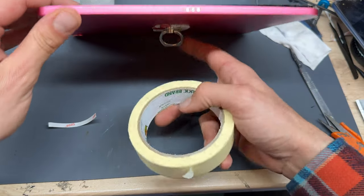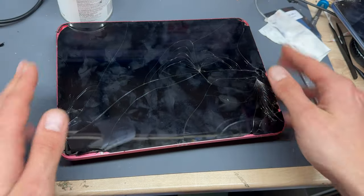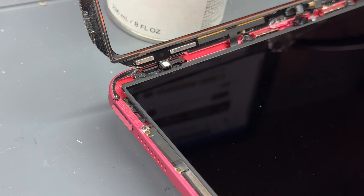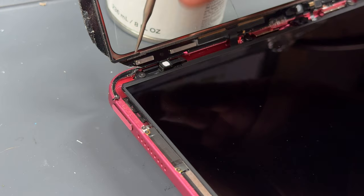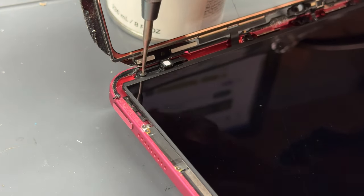Just a little note: if you've ever got one of these pulley ring things on there, if you pop it on a bit of tape and rest it on there it means it'll sit fairly flat — a top secret tip from the iDoctor himself. To begin disassembling this iPad we're going to remove the eight T2 screws that are holding down the LCD, four on either side.